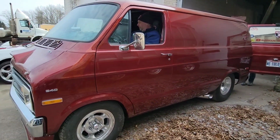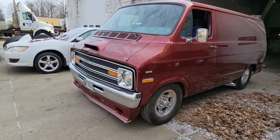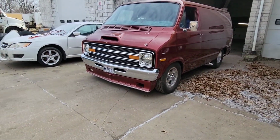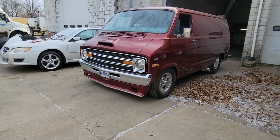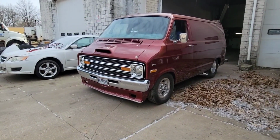We've been fighting the carburetor tune with going back and forth between open headers and exhaust, and it just gets so fat and fouls plugs out that I didn't want to deal with it anymore. We have no mufflers, no back pressure, and this is the way it'll stay. So now we can put a perfect tune in that carburetor, and it should just be right all the time.